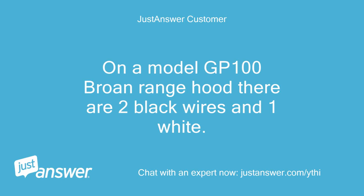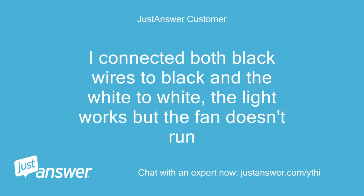On a model GP100 Broan range hood there are 2 black wires and 1 white. I connected both black wires to black and the white to white. The light works but the fan doesn't run.